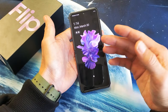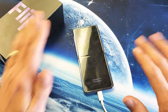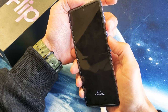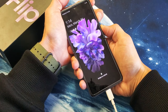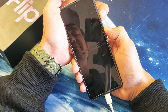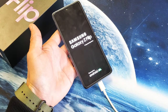If you're still down, the next thing I want you to do is plug your Z Flip in. Give it power and let it charge for about five minutes. After five minutes, come back and force restart again: volume down and power button, press and hold at the same time. Make sure it's still plugged in while you hold both buttons, waiting for the Samsung logo to appear. There it is — go ahead and let go. Hopefully you guys are up and running.